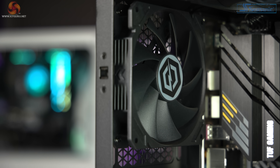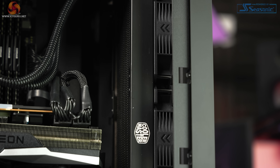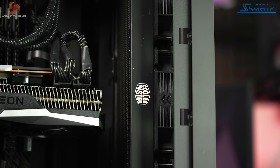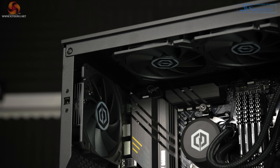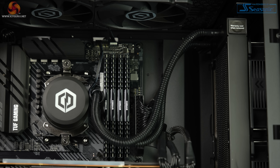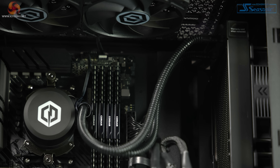There's also plenty of airflow within the case because we have those six 120mm fans. Three are intake fans in front of our radiator, two exhausts on the top, and another exhaust on the back. The radiator is at the front of the case with the pipes at the top — the pump is below the top of the radiator by a considerable amount, so the pump will remain wet. The potential downside is that air may accumulate at the top of the radiator and could lead to a waterfall effect where the system cooling is kind of noisy.